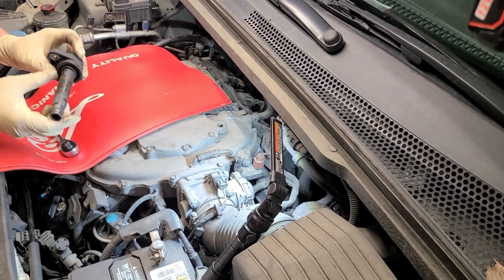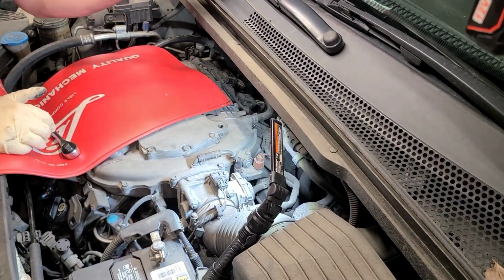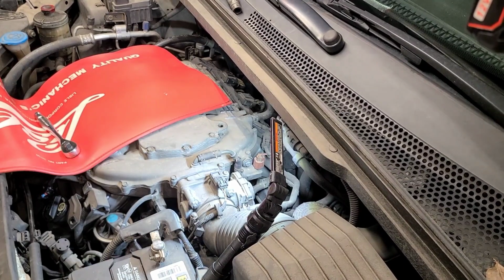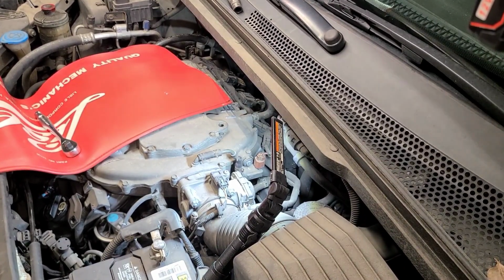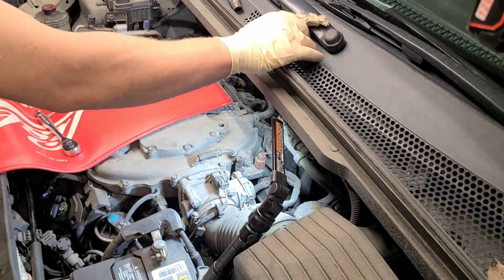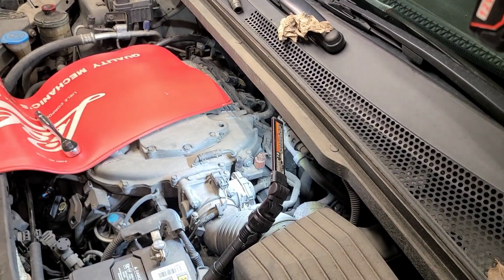And we have no oil inside. A little oil on the outside, but that's kind of common for 200,000 miles. But it's not leaking inside or anything. The coil packs don't look bad. If you want, while you're in here and you can afford to, or if you feel like it, you can change out your coil packs. So let me get one of these plugs out back here. And I'm glad I didn't have to remove the intake manifold to do this job.